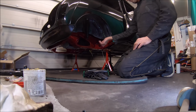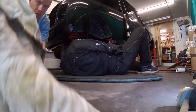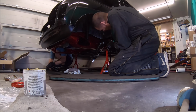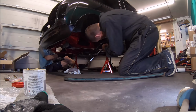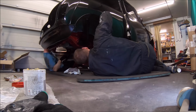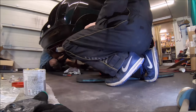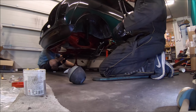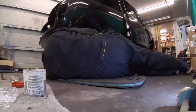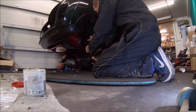It's always nice when you're reassembling new bits and clean bits like this. I always found, when I was putting old radius arms into a greasy old subframe where it's had loads of grease pumped into it over the years, that getting those inner and outer rubber seals to stay in place is difficult, because they always pop out when you put the radius arm in. Yeah, it can be a pain because you don't notice till it's all back together. Then you've got to take it apart again to either uncrimp the seal or make sure it's fitted all right.